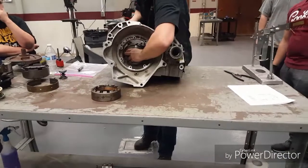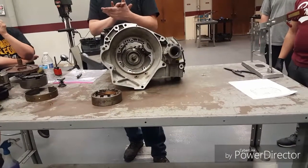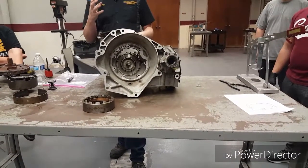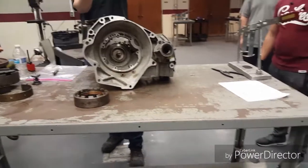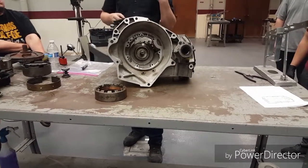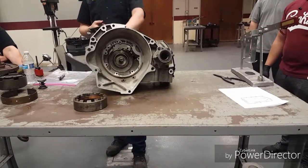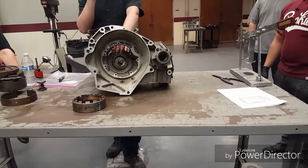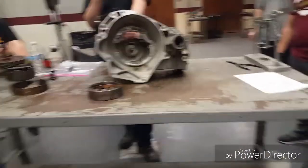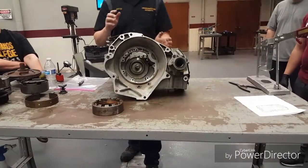He's going to sit in here. I can pinch it together and slide that in. Now we can put the one-way clutch in. A one-way clutch cannot simply be shoved back into place because the springs have moved the little bearings back down and their overall diameter is now smaller. What you have to do is set that one-way clutch in as straight as possible and start to rotate a little bit clockwise — you'll feel the bearings start to pop in. If you hear a click and it falls out, you've got to pull it out, get your bearing and spring back into place, and take a few shots at it.